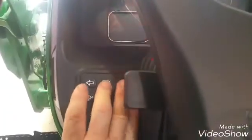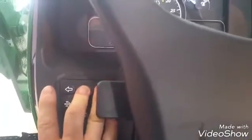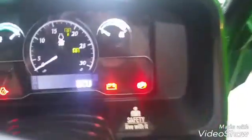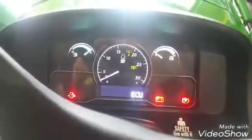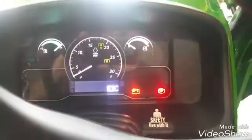While holding the display mode button down, press right, left, left, right, left, right. I'm going to do it with one hand to show you — holding it down: right, left, left, right, left, right. Now it says ECU. Press the right arrow key three times — one, two, three — to get to ICC mode, then press the display button again. Now we're in ICC mode.